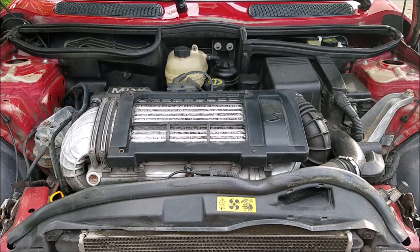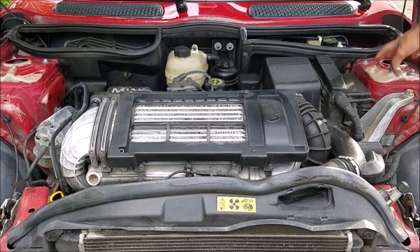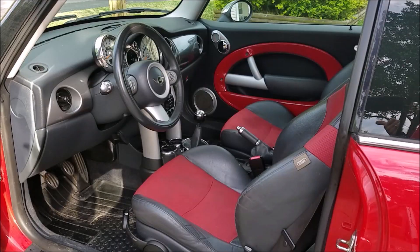One thing that's unrelated to the engine but is under the hood: we're going to be reinforcing the strut towers. We've got some braces from ECS Tuning that sandwich on top of the tower to support it, because these are notorious for mushrooming. The passenger side is pretty bad; the driver side isn't too bad, so we'll have to do a little bit of work to get that installed.